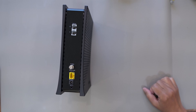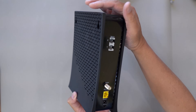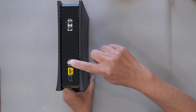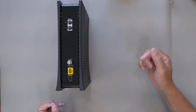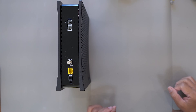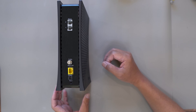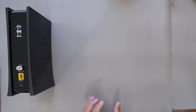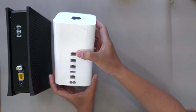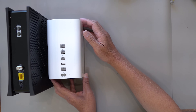In this example I use a hardware called a Brax router, which is one of the products I make. This is a modem from my cable company — an Arris model from Spectrum. You can see where you plug in the cable and where the internet comes out. Some companies sell you a modem combined with Wi-Fi, but the problem is sometimes you can't configure it — the carrier gives you a pre-configured Wi-Fi and you can't set it up the way you want.